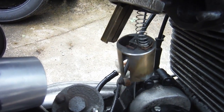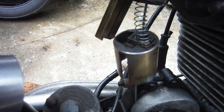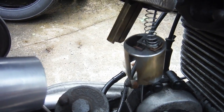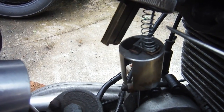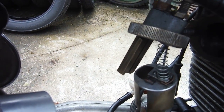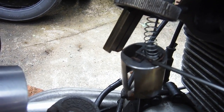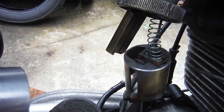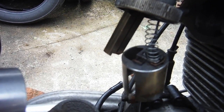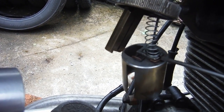And I was thinking about it, and I looked on Hitchcock's website, and they've got all the parts lists for the carburettors, and sure enough, after you've put the throttle cable into one of the 2 series pre-monoblock carburettors, this is a 289, there's a little split pin that you're supposed to put in through a tiny hole to lock the throttle cable in so it can't come out through the slot, and I'd never put one in, so I've got one there now.